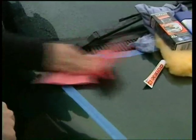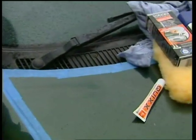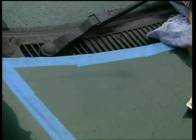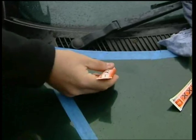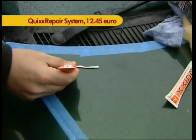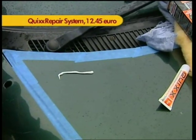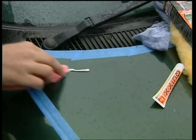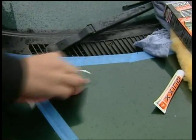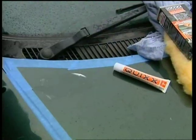So we have a scratch here — you can see the scratches clearly. If you have scratches like this, what we have is called a scratch repair kit. It's a polish that lightly weathers the paint. What you do is rub it in with force for about two to three minutes. Then you apply a second finish, which is basically a wax sealant, and that will help to remove the scratch.